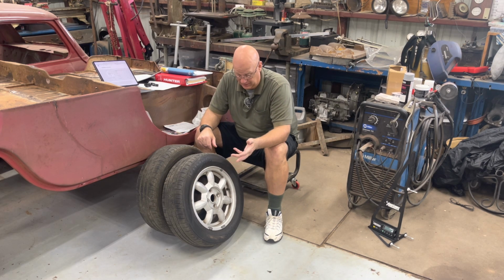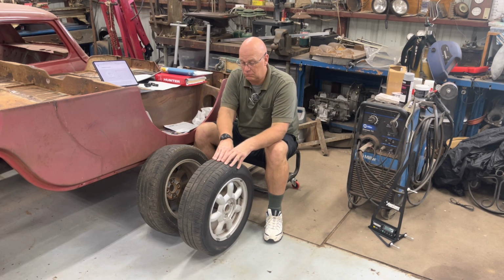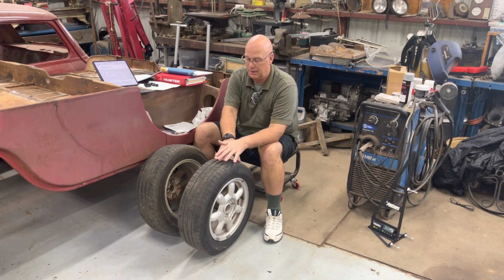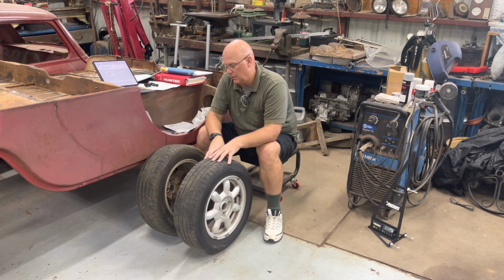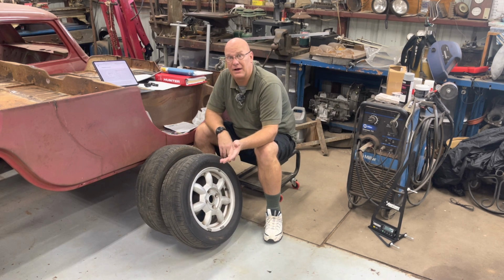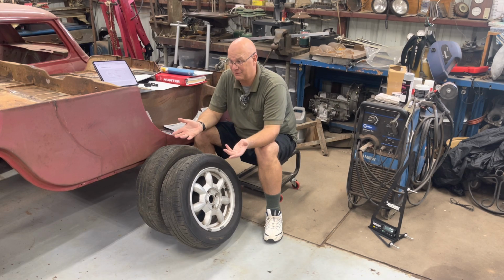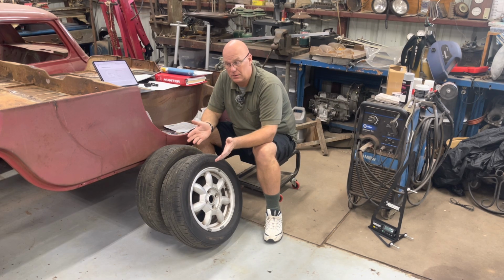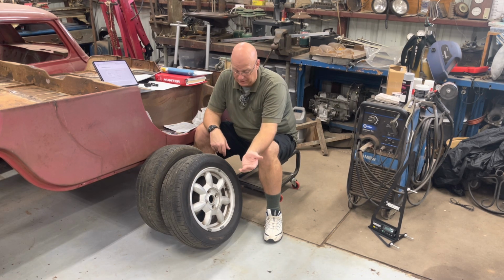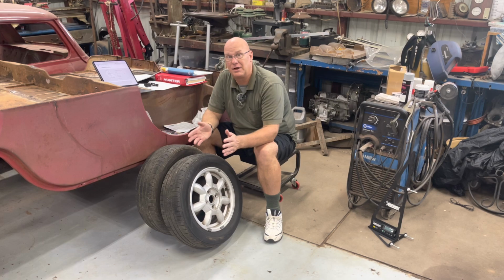Well, my floor doesn't have that. You want to be able to move it without any drag or the tire hanging up on you, and you want to know when you get to exactly 20 degrees. So there are some graduated caster plates out there. There's some on Amazon between $150 and $200 a set. That means you have to spend $400 to do the whole car. That's the best way of doing it. I've mentioned in another video, take a trash bag and put some silicone between the layers. Supposedly that works. I've not tried that yet.